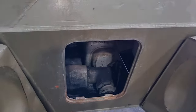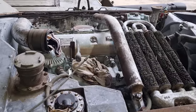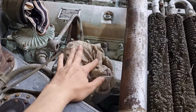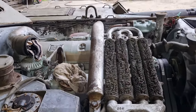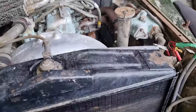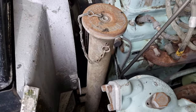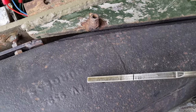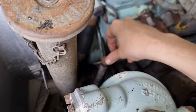Back on the outside — it did come with a spare wheel, it came with everything. We just took it off so we could actually access it. Yesterday I also pressure washed the engine. The owner took off the carburetor some time ago, so we're going to have to run a carby kit through that, remake it and put it back on, and then we can do a Will It Run. But it's actually not that bad — even the oil looks brand new, which is really good. So we're not at all worried, and there's no water in it either, which is fantastic.